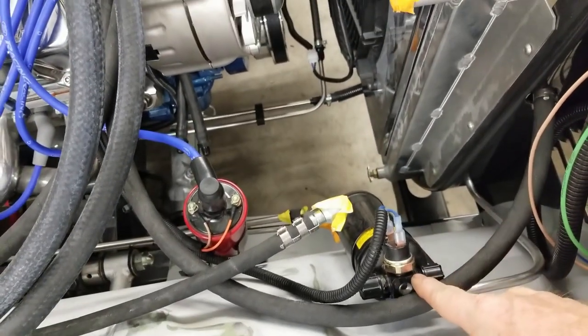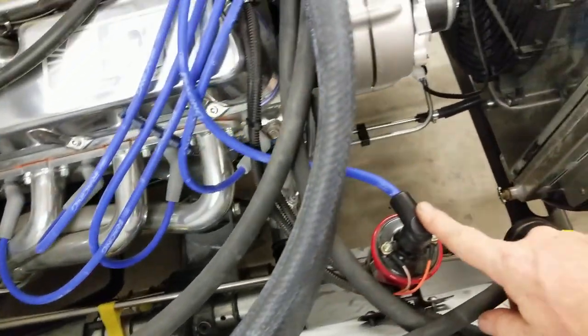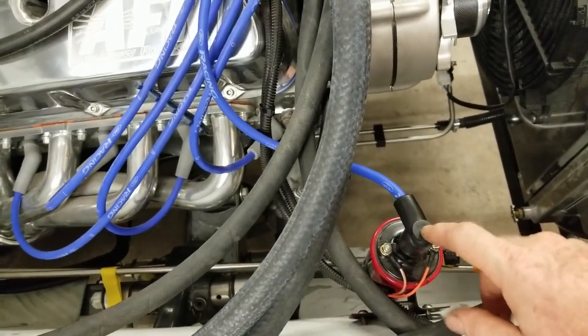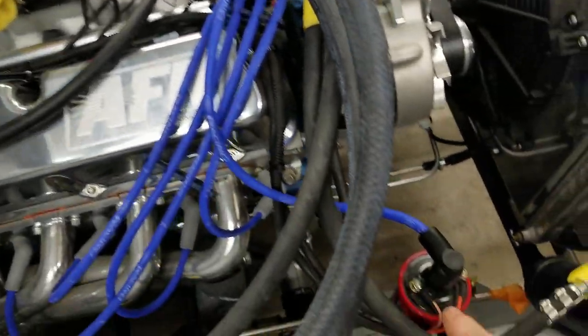We have our binary pressure switch for our AC. That's wired. Put in some tubing. And then we transferred over the connector on the top here for our distributor wire, so for a coil wire, excuse me. And then we extended the harness for the coil wires themselves. And then we neatly wrapped everything down into here. And it goes right into there.